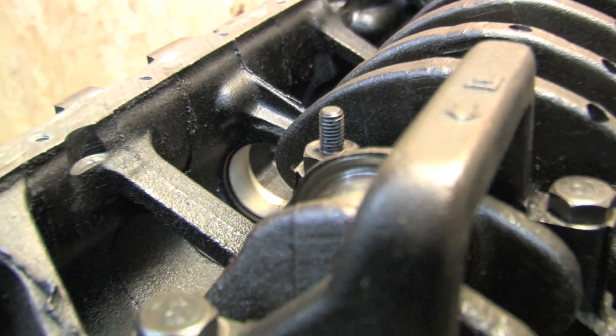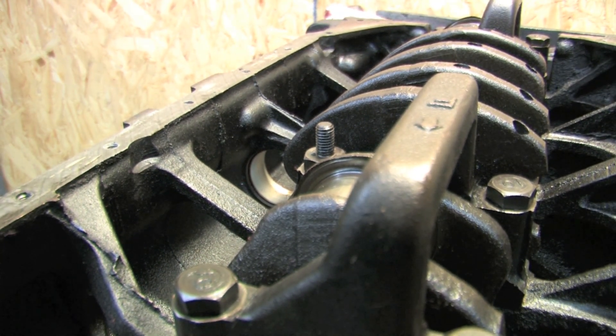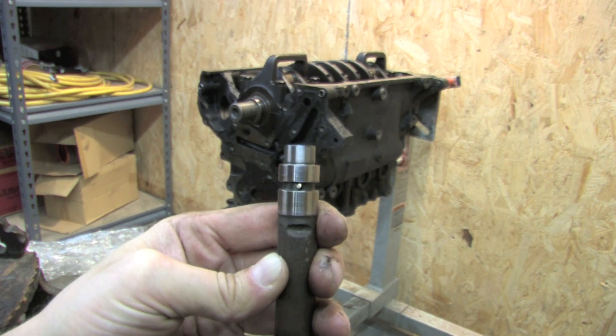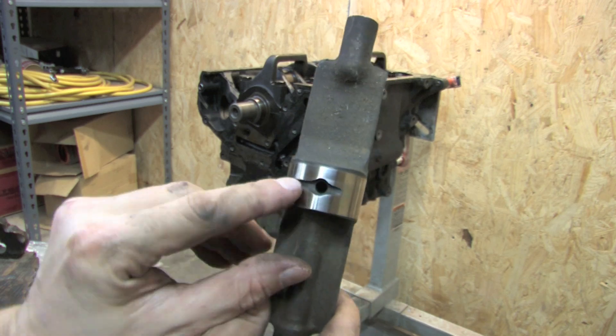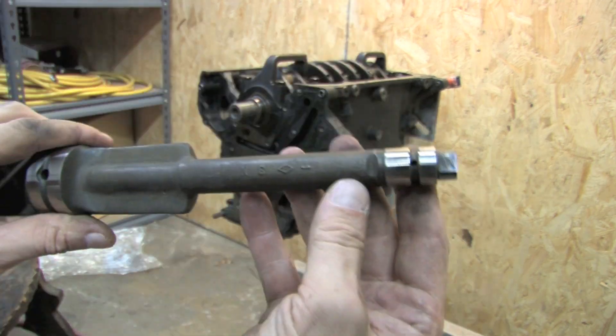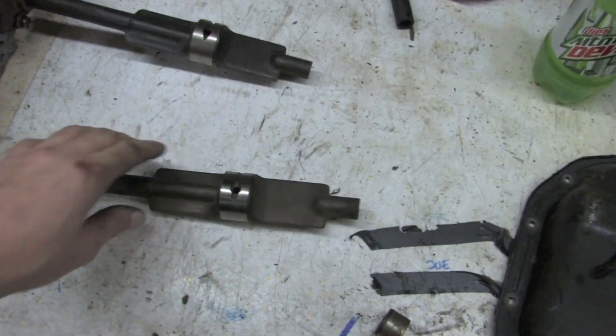This is the bearing for the oil shaft. The oil shaft is also called the rear shaft and it's closest to the oil pan. You can see the front oil hole between the journals which receives oil from the pump and supplies the rear journal with oil. The oil shaft is hollow in the middle and it serves as an oil gallery. That's why the inner bearing in the block doesn't need oil holes.